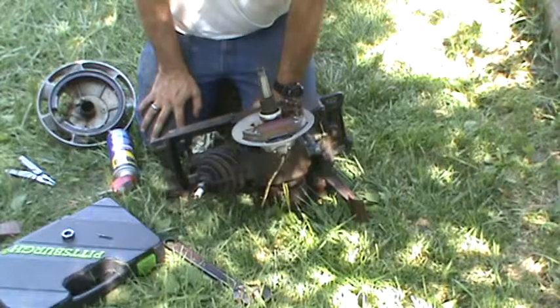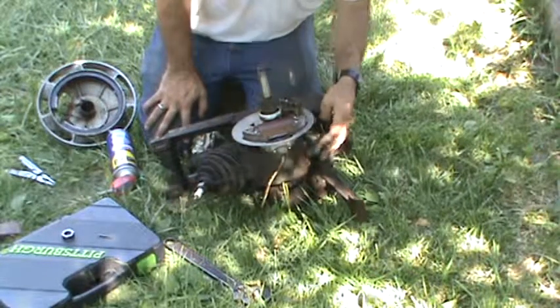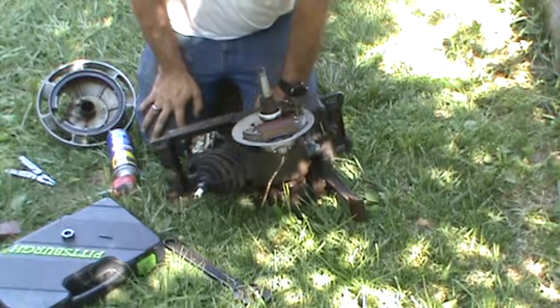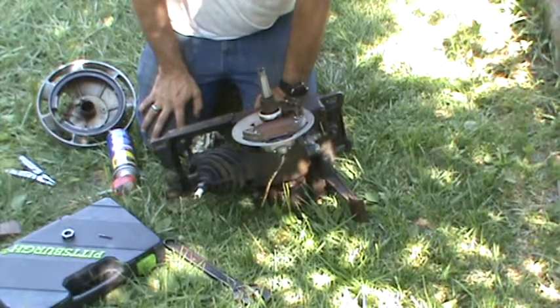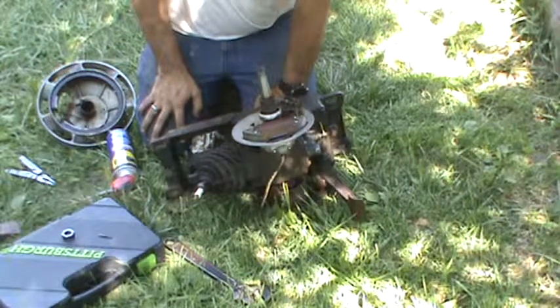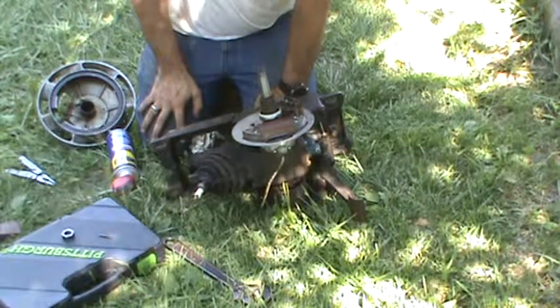It's not worth screwing up something like this. Some of these screws are very soft — if there's some over where the carburetor is, there are some little brass screws and they're very soft. You have to have a well-fitting screwdriver. Screwdrivers aren't that expensive — there's no reason not to modify one and make it fit.